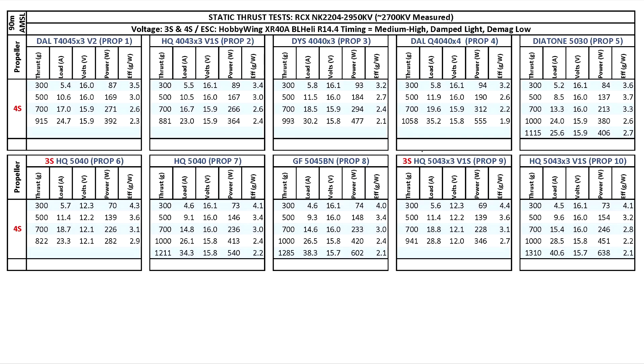So those are the thrust test results. Overall a pretty good motor for ultralight builds on 4 inch and 5 inch with bi-blade props. On 3-blade, possibly on 3S, it could be good on 4S — though I'm not sure if the motor will withstand the load. This is static testing with the 5043x3, so amps are quite high, but on a very ultralight frame the props are going to unload quite a lot — probably up to 40% less amps. So it should be able to handle the 5040x3. Always a good idea to check motor temps. Thanks for watching, and until the next video.